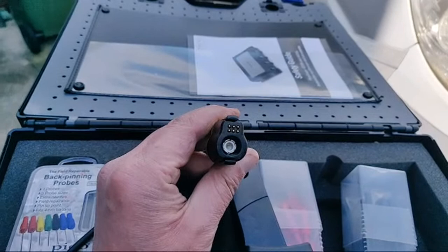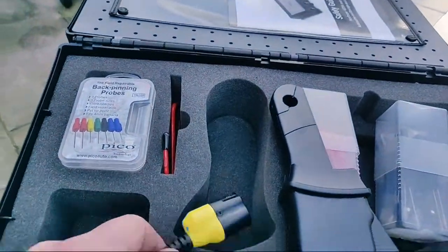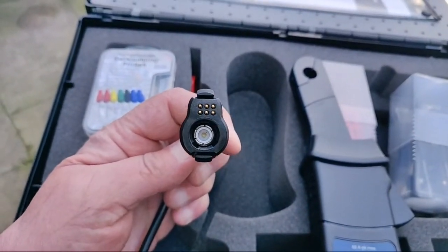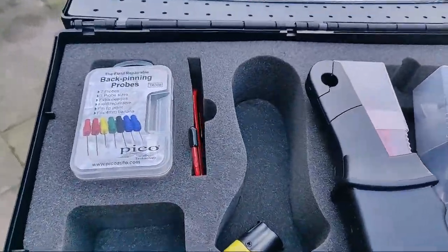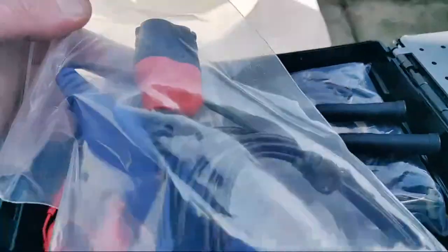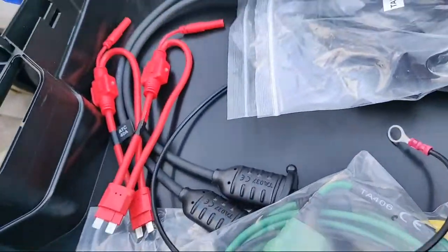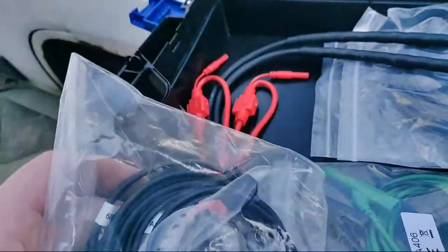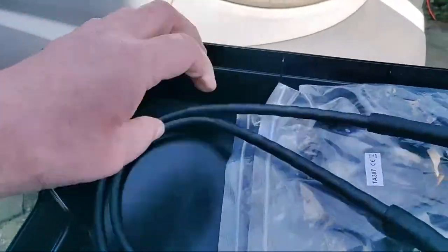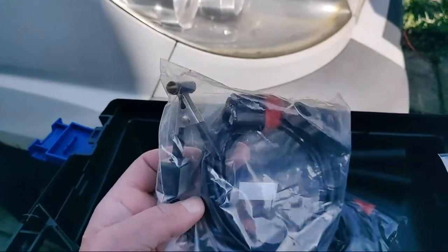You'll notice the profile is a lot thinner and the jaws are actually a lot wider now on this new 60 amp clamp, so that'll be good for battery drain. The good stuff's at the business end - we've got BNC plus, which means the scope can auto-detect what sort of probe you've attached and will automatically select the correct probe, avoiding setup issues. It will also light up blue and yellow to tell you what's connected. We've got setback probes with BNC plus, four leads - red, blue, yellow and green - and the attenuated probe, which I love.